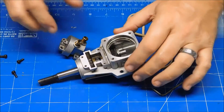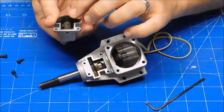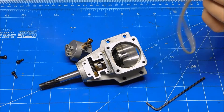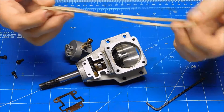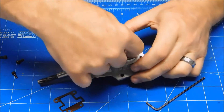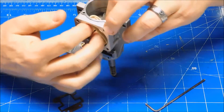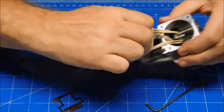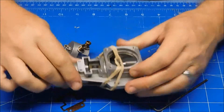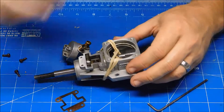I'm going to attempt to set the timing of this engine without being able to insert my screwdriver into the timing hole like I would like to, but I think I have an idea. You may see this long rubber band — unfortunately it's the shortest rubber band I have — but I'm going to try something I've never tried before: twist this rubber band up and loop it over the crank pin and pull it around in the hopes that it will hold my crank pin at top dead center.